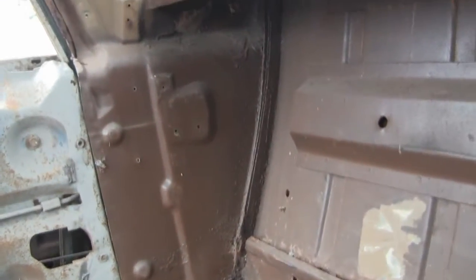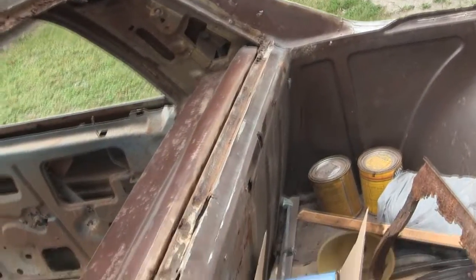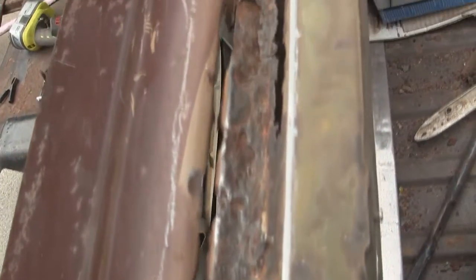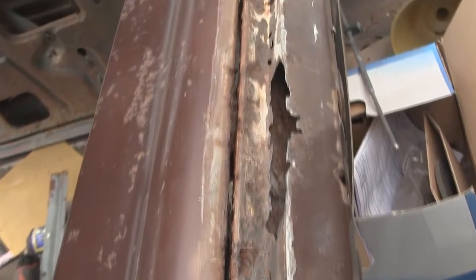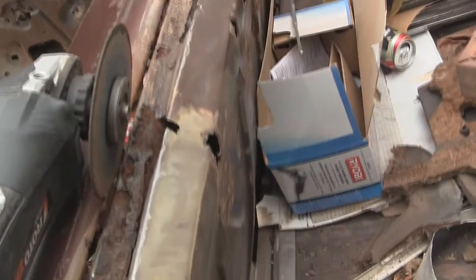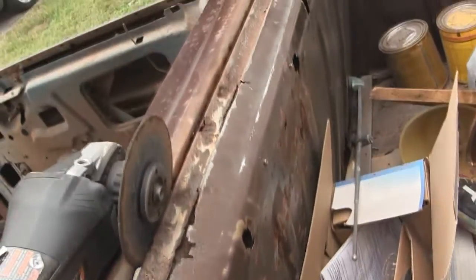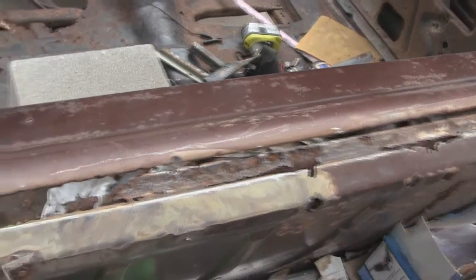As I suspected, this upper shelf is definitely connected to the upper rear back panel section. What I did basically is come in here with a heavy-duty screwdriver and open the seam up a little bit to where I could find all my spot welds. What I'm going to do is take the thin wheel on my cutoff tool, stick it down, and cut each one of these spot welds one at a time so I can get this top shelf separated and then pull it out.